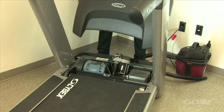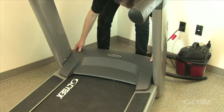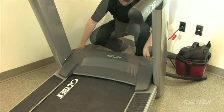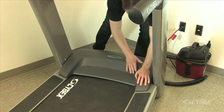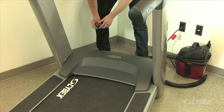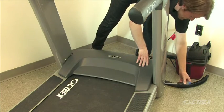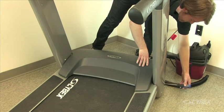Place the motor cover into position vertically by aligning the 2 tabs and 4 plastic connectors. 2 plastic connectors are mounted in the front cover and 2 in the motor cover. If the motor cover top does not fit properly, loosen the side screws on the front cover as needed.